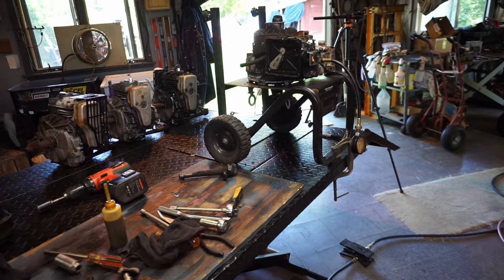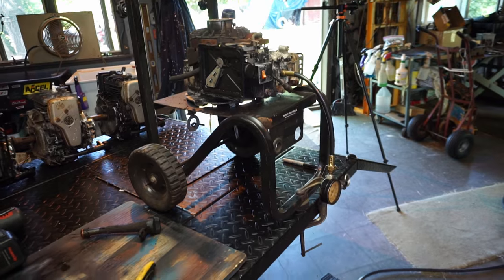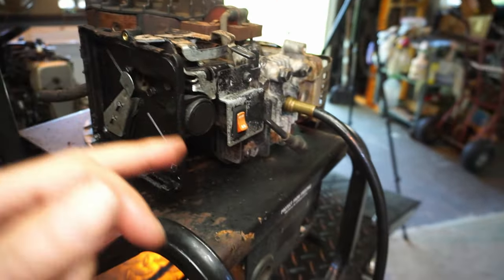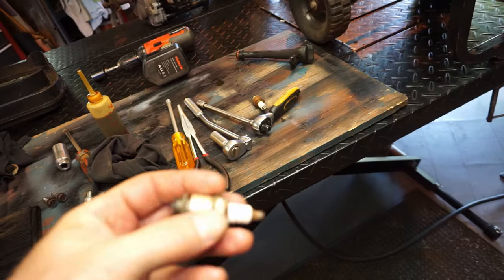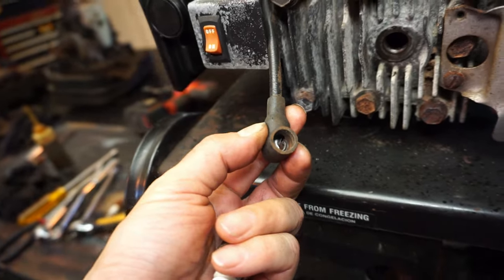What we want to do is dump the oil, get everything cleaned up, get all these parts clean. We're going to bench run it - bench run it here and see if there's any reversion. We'll get all this apart and if there's reversion we'll know. Look at the plug - plug's a shot. Look at the end, it's all rusted. It has spark but it ran. It's an auto light too.